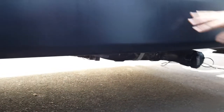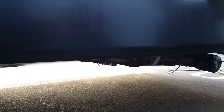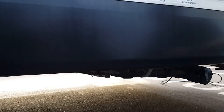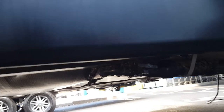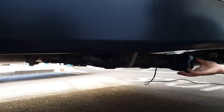This area shows you the black holding tank and gray water holding tank valves. When you use your toilet, it drains into the black tank. Your sink and shower drain into the gray water tank. The actual tanks are underneath; this just shows you the valve locations. When the tanks get full, you go to a dump station and connect your sewer hose here to drain them out.